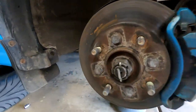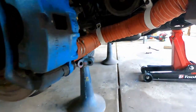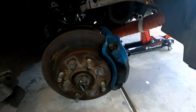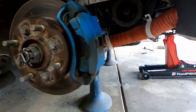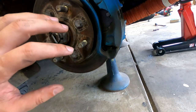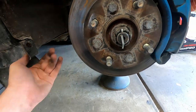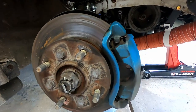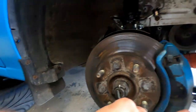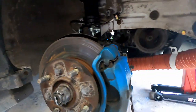The car's up and wheels are off — it's all pretty filthy after quite a few track days. I've also noticed a tiny bit of an oil leak underneath, but that's future Matt's problem. What I want to do now is change out the front pads: pop the caliper off — from memory it's 12mm on the back — pull the pads out and have a look at them. I also want to give the disc a clean-up and wash the inside of the wheels while they're off.